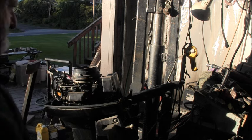That's an indication, and we'll find out with this one, that something bigger than that recoil was the problem. The problem caused the recoil to be in the condition it's in. Pull and pull and pull. Starting fluid and pull and pull and pull. New spark plugs and pull and pull. You get the picture. So when I see one like this at a yard sale, it's got the brand new spark plugs, the recoil's all destroyed,